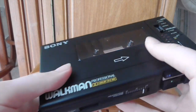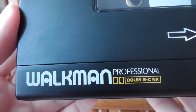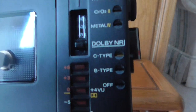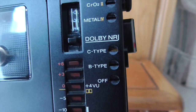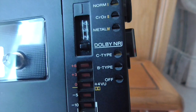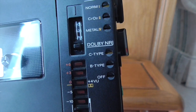The Dolby B and C noise reduction was quite a thing for the time. Walkmans started to include Type B reduction, but not many if any Walkmans had Type C reduction — this just helped filter out more noise. It does play into the sound quality quite a lot. Another interesting feature on top is the different tape types: it's set to norm — Type 1 normal tape. Most Walkmans could play Type 2 chromium oxide tape, but this also supports metal tape, Type 4. You can really play all different kinds.